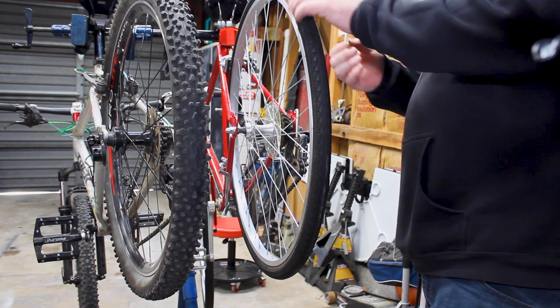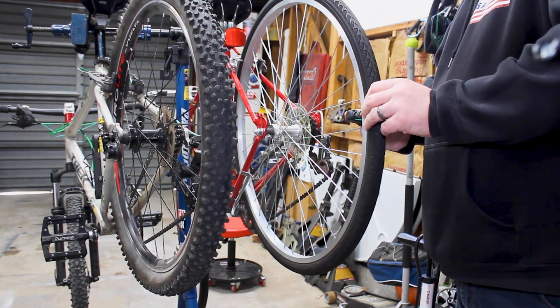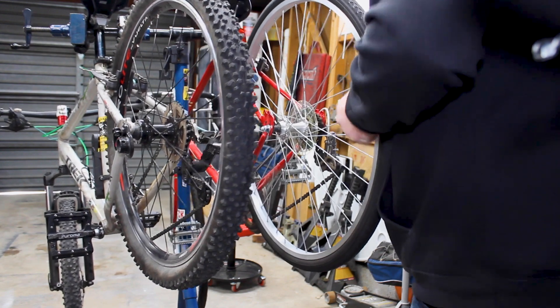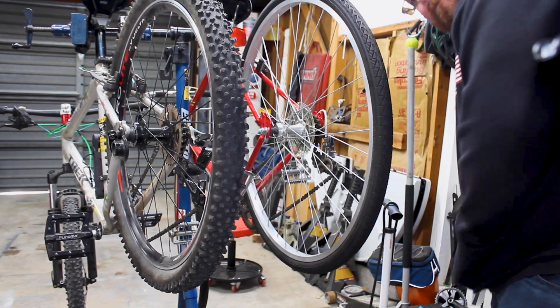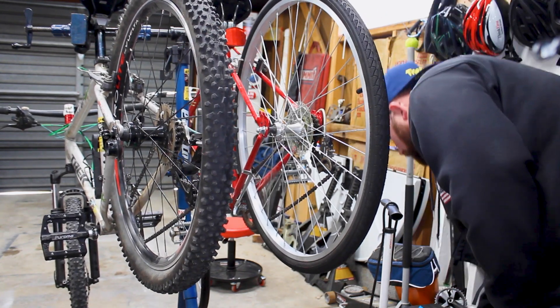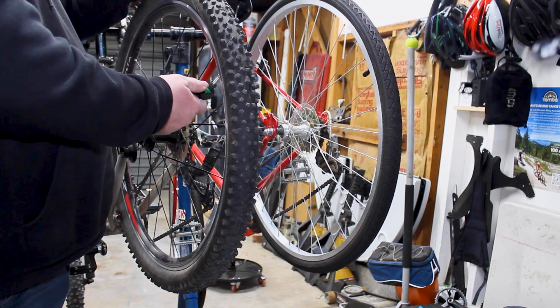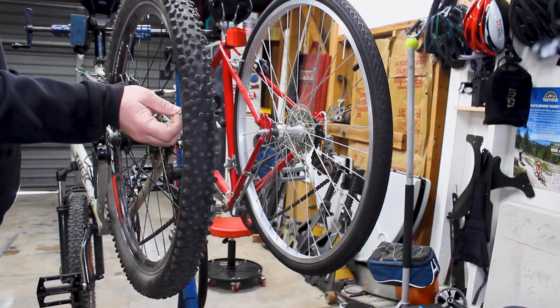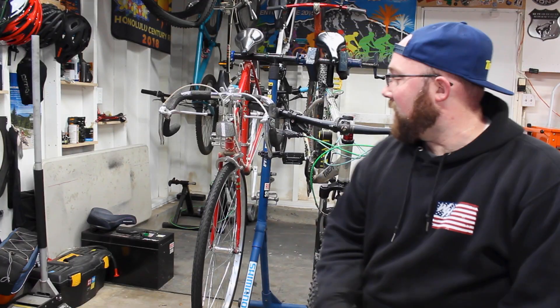On to CO2. We're going to start with the Galaxy since it has higher pressure, using a CO2 cartridge from Leland Gas Technologies. We got 80 PSI in the back of the Galaxy. Then we'll do the Trek 3700 — we're going to run 30 PSI on the mountain bike. So we have 30 PSI in both tires on the mountain bike and 80 PSI in both tires on the Galaxy. Tires are all set.